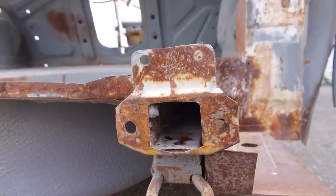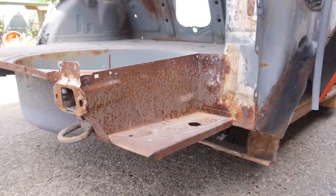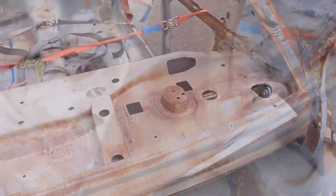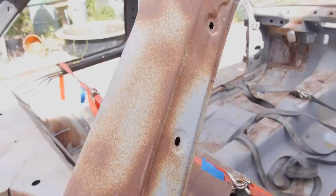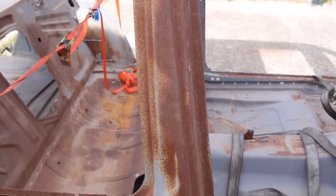Here's the plan. I'm going to blast the entire car and remove all of the surface rust. At the same time, or on a second pass, remove all of the old primer so the chassis is completely bare metal. At that point I can apply two wet coats of 2-pack epoxy primer to the entire chassis to seal the metal and prevent any further rusting. Then I'm ready to start the real welding work.